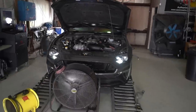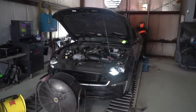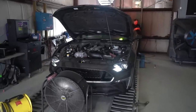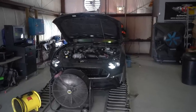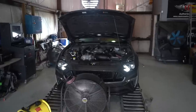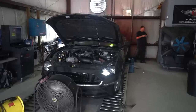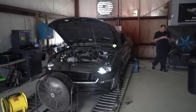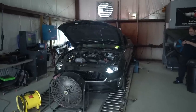That's 20 more horsepower than my Corvette, which I spent a lot more money on — opening up the motor, installing a cam, and all the supporting mods. This car makes 460 horsepower from the factory. If you factor in a 15% drivetrain loss from 500 wheel horsepower, that's somewhere around 570-575 horsepower to the motor. If Ford were selling this car off the lot with these mods, they'd advertise it as a 575 horsepower car. Sean thought it'd make maybe 490, I guessed 480 — we were both lowballing it.